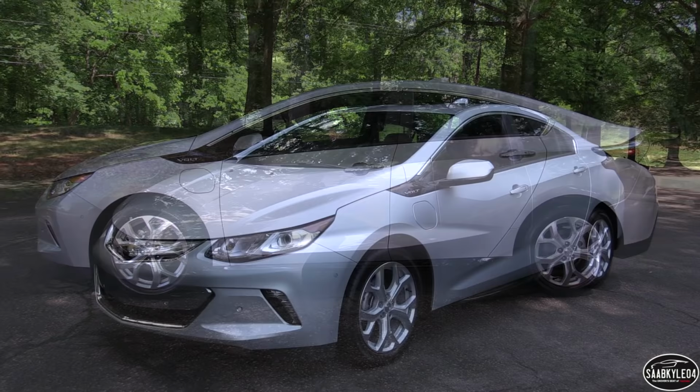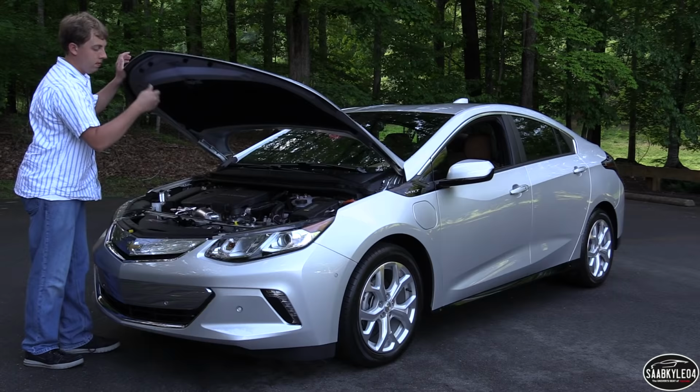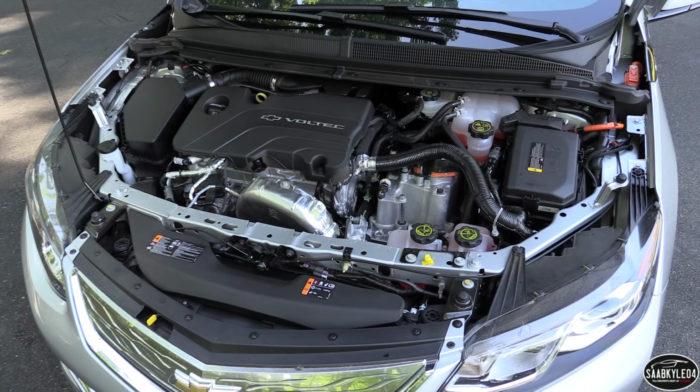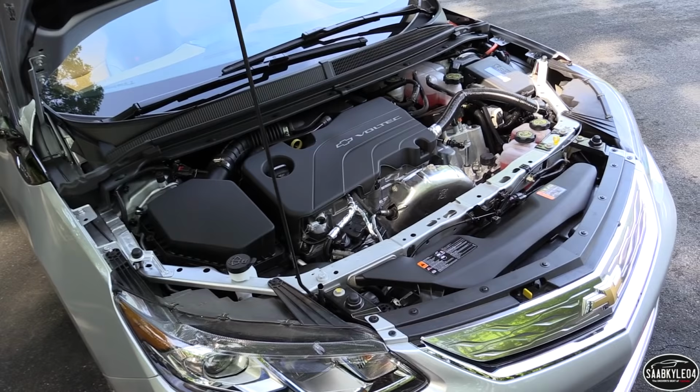The second generation Volt features an all-new Voltec propulsion system consisting of the battery, drive unit, range extender, and power electronics. Compared to the prior setup, both EV range and overall fuel economy see big jumps, making the Volt an even more efficient commuter car. The cell chemistry in the lithium-ion batteries has been revised, increasing total storage capacity from 17.1 kWh to 18.4 kWh. With the ability to hold more energy per cell, the total cell count was able to be reduced from 288 to 192, helping shed 21 pounds of weight and making things more compact.